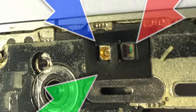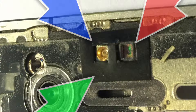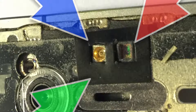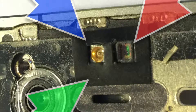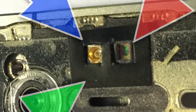This means that when you are making a call and you raise the phone to your face, the screen will now properly switch off and disable the digitizer. Whereas if the proximity sensor is faulty, the screen stays on and obviously the screen is still receiving false touches from your face, so your face is dialling digits and controlling the phone with your face, which is undesirable.